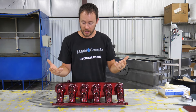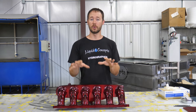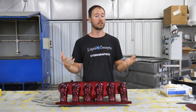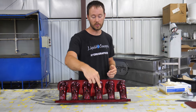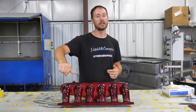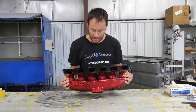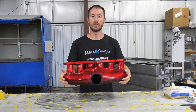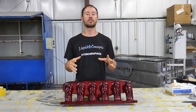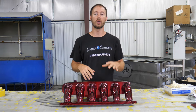You probably saw we had all of these holes taped up — that's one thing that's definitely critical whenever you're doing stuff like this, especially for an engine. You always want to make sure everything is taped up and plugged 100%. We had all our silicone plugs in all of these areas so that whenever they go back to screw everything in, they can literally put the bolt in, screw it in, and everything's going to be perfectly fine. Everything that's been taped off down here as well as on the intake part means everything will go back together, the gaskets will mate right back up to the existing part, and everything will be good to go.